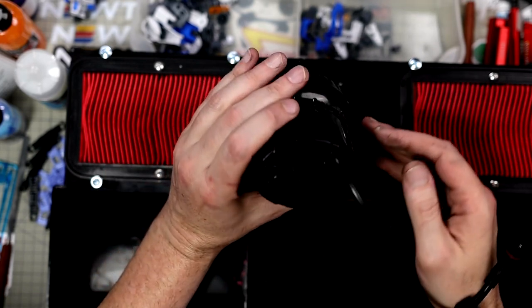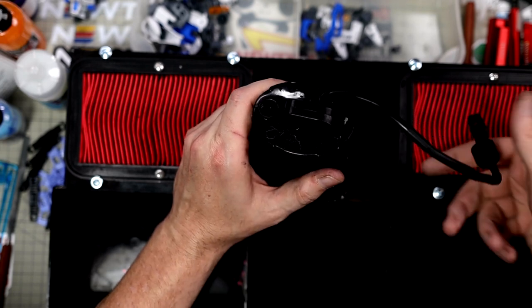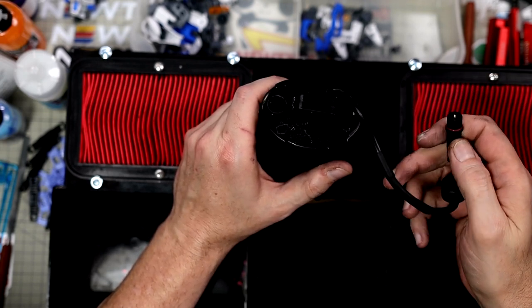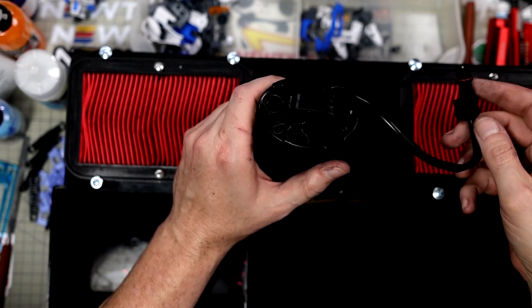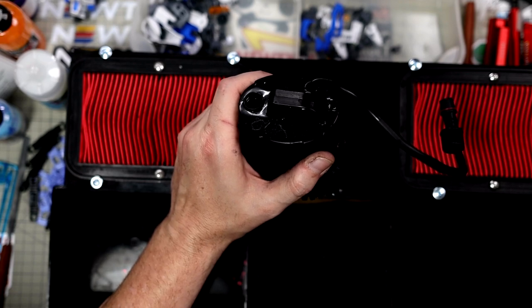And then to take out the pump, it's really simple. The hose plugs right into here. It just unscrews. And then this is the power cable. It's just two prong. It only goes in one way. You plug it in, tighten it down, and you're good to go. I thought it was going to be a lot more involved to get out that pump, but no.